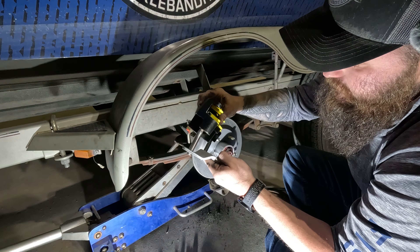Just going to clean this extra grease off. The next thing we're going to do is get this caliper and bracket put on with this new updated design. You take this caliper, slide it right over those pins, there's a fancy little rubber stopper out of the middle of this caliper here, and we're going to slide it right down over the back — it'll drop down just like that. Then with the new hardware supplied, we're going to put the four bolts right back in that bracket.